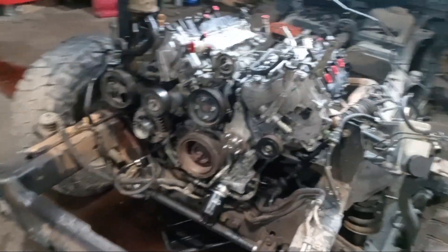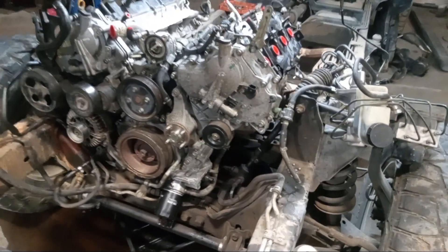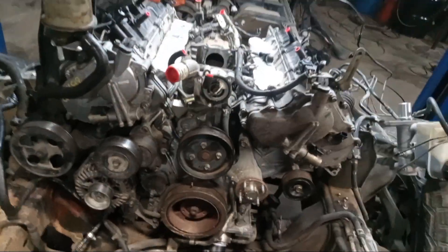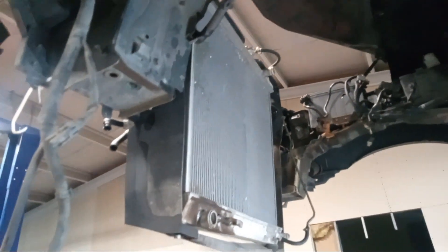This thing calls for like 25 hours to pull out the front of the truck, so I decided to skip that. It says to pull the intake manifold, the exhaust manifolds, and you have to take the transmission out before you can ever pull the motor out of the front — after you remove the radiator and all that stuff, which the radiator just slides up with the cab.